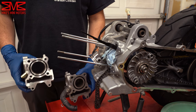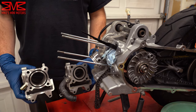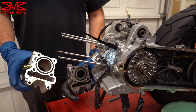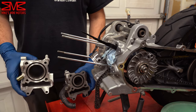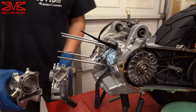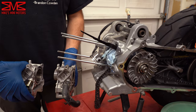It's now time to put on the new cylinder. But first, there's still a hose on the old cylinder — it's easier to swap that over now. I'm also going to spray it with some carb cleaner because they often put a coating on them to prevent corrosion during shipping and storage. You can see it's slightly offset from the face, so try to match that onto your new cylinder.